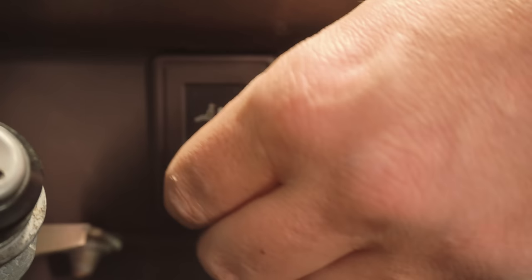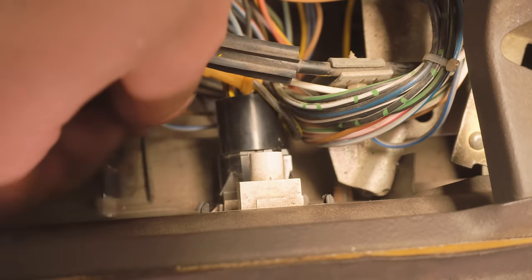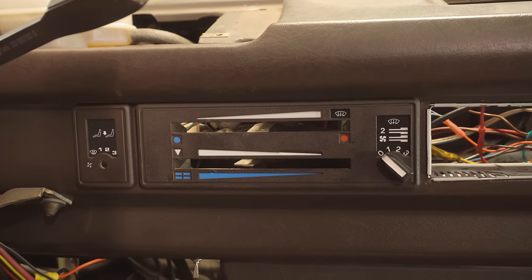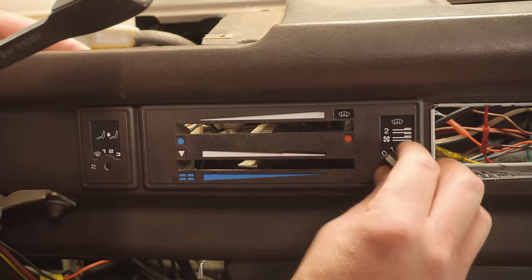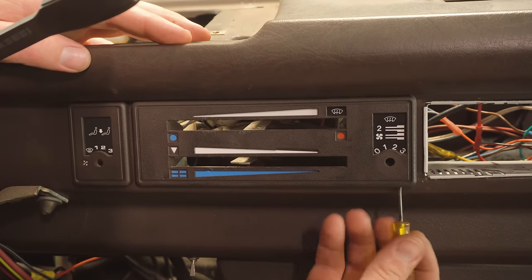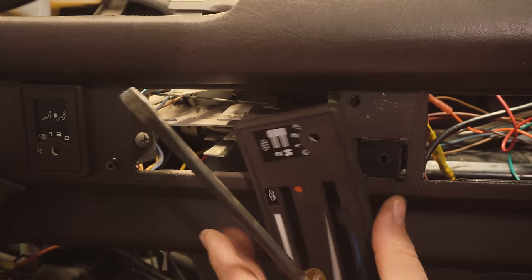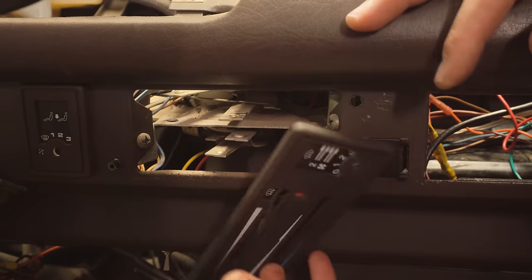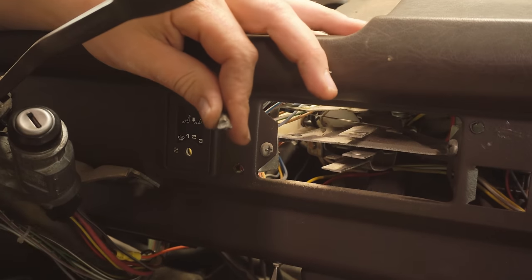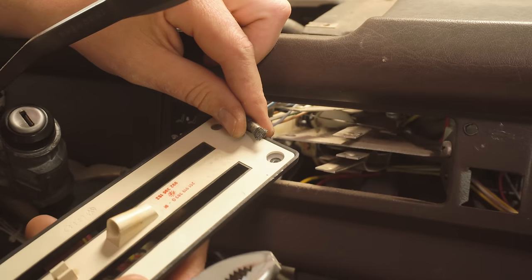For the rear heater control, just pull the dial from the front then go behind and unplug the light bulb and the switch from the panel. The main heater and temperature control panel removes in a similar way. To do this, remove the switch dial on the right hand side and pry from behind the panel with a flat blade screwdriver very gently. It has two plastic prongs that register into two metal receivers in the dash. Sometimes these posts will break — you can use epoxy to repair them, double-sided automotive adhesive tape, or drill a hole and use a screw with a washer and a speed clip.